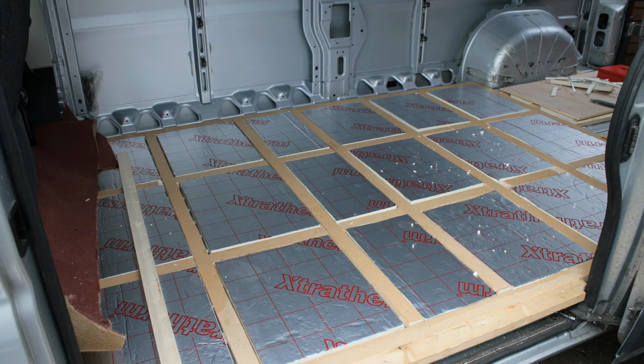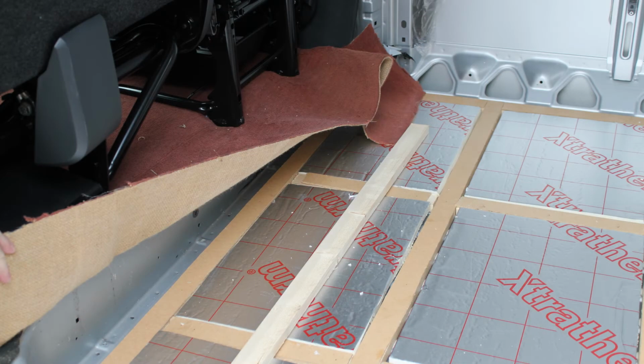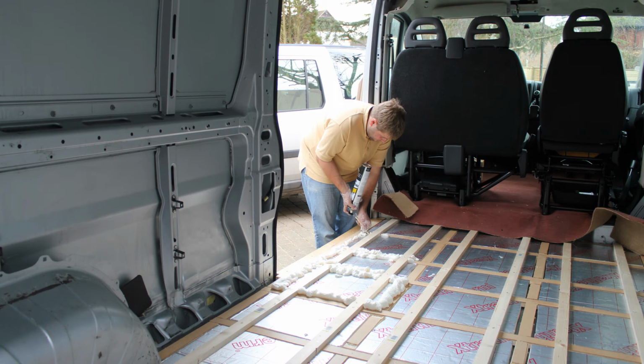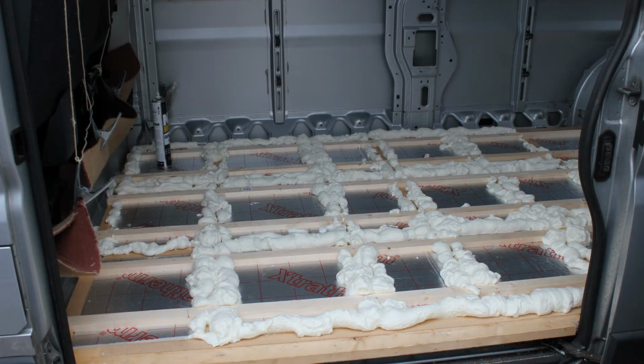Once the insulation was cut to size, I then bedded it on a layer of silicone sealant and allowed it to dry. My next stage was to fill the gaps around the insulation board using expanding foam. But before I did this, I wanted to temporarily hold all of the insulation in place to prevent the foam from lifting the boards. My method was simply to put some extra battens over the top of the board with a couple of screws just to hold it in place. I then used expanding foam to fill all of the gaps around the insulation and allowed this to dry overnight. The following day I then got a sharp knife, again the bread knife, and cut all of the foam flush with the insulation. Now I had a fully insulated floor, it was almost time to fit the ply.